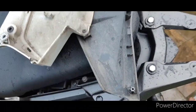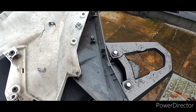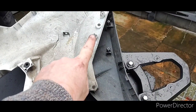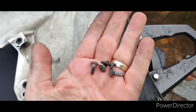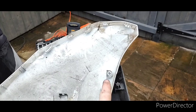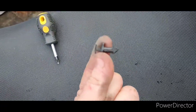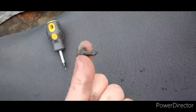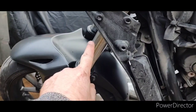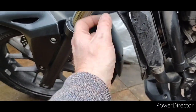You have to take the black piece off. That's got one, two, three screws there, one screw there, and a popper — so there are four screws in total, all Phillips head. They're a bit of a bugger to get to — I'll show you how. And this top one is one of these wee plastic unscrews where it sits flush, you unscrew it and it splays open. Where they are: screw, screw, screw, and screw. You're getting to these from this side. And this one's a splayed one.